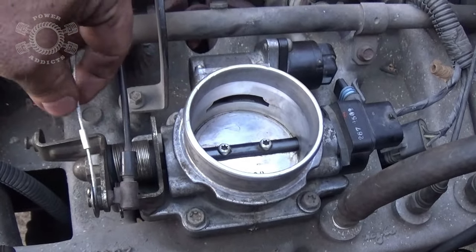The number six cylinder doesn't have the compression it should — it's just making it not as powerful as it could be. It's not creating runability issues — it still idles smooth — it just uses oil. I put oil in every so often. I've got four more complete 4.0s — one in my carport, one on the engine stand, one in the Cherokee I'll be converting to a camper rig, and the one in Rust Bucket stays until I'm ready to do the V8 swap. So I've got engines to build and that'll come up someday soon.